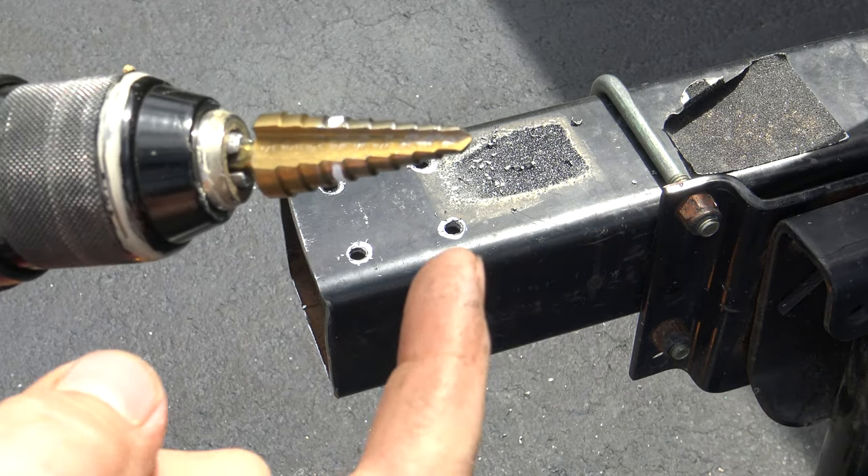As you can see, right there is the original hole and I just reused the bolt back there. The new kit does not come with your safety chain bolt. For the chains, I use quarter-inch by ten-feet, which usually leaves about a foot left over in chain length.